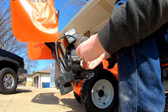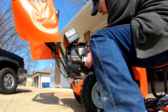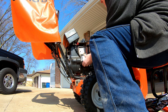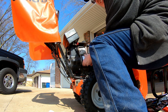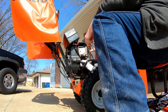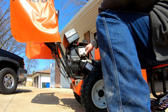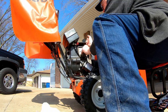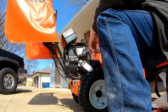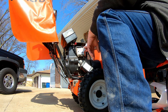The starter has little grooves in it to fit on and go up and in. I need to work it in and not lose my screws. I need to take this off to get at those bolts — I've got a little crescent wrench here. Also, I'm going to use blue Loctite on my bolts so I don't want this to happen again.